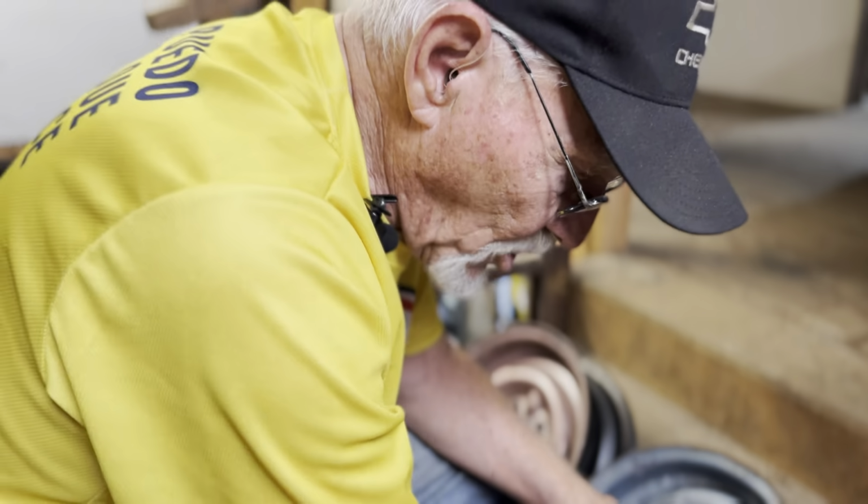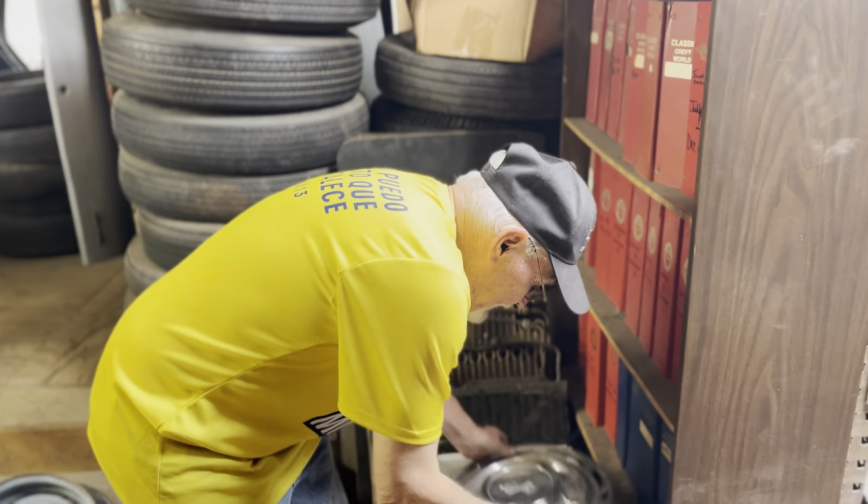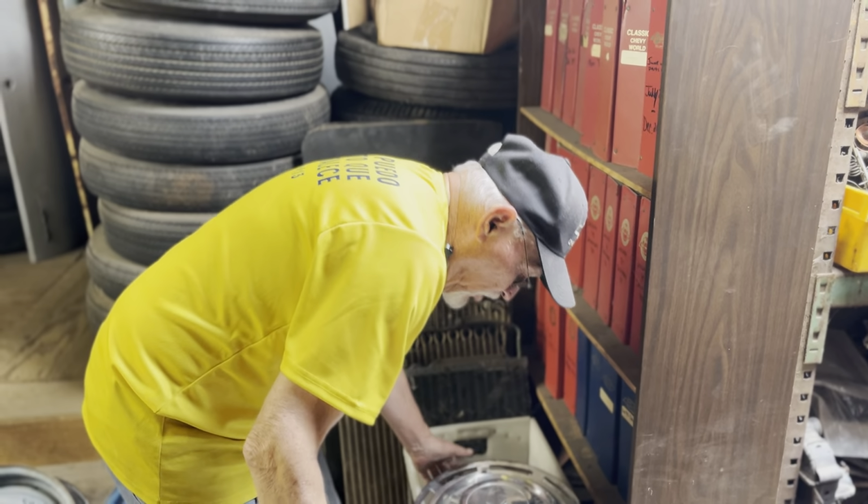The reason often why original wheel covers will not stay on a car is because people have the wrong wheels. And let me explain why that's important. I have in my hands, first of all, this 1957 wheel cover. If you look up close, you'll see this outer solid ring. This ring has some little slots in it so that it can expand ever so slightly, and it is designed to snap over the 4 nubs that I just showed you. Well, if you happen to have a non-original wheel, you put this wheel cover on it, it will not stay.